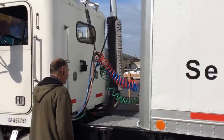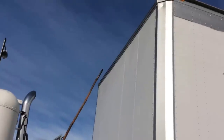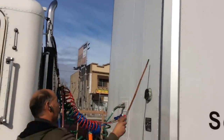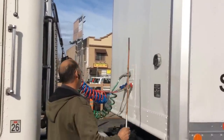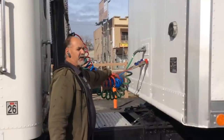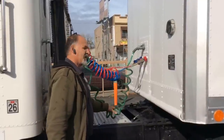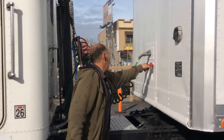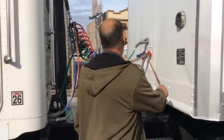Trailer. We'll start with our clearance lights—they're amber in color, not broken or missing, and in good working condition around the trailer. We have the header board—always clean, no graffiti, and no damage. It's in good condition. We have our air lines—red is emergency, blue is service, and green is our electrical. No cracks, no leaks, and not dragging on the catwalk. They're in good condition. And the glad hands have no missing bolts, no leaks, and are well secured. They're in good condition on both ends.